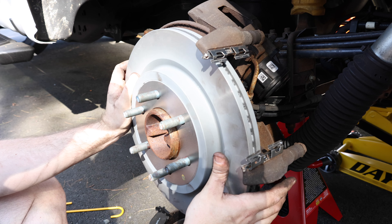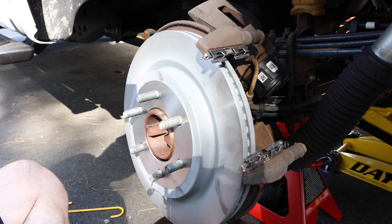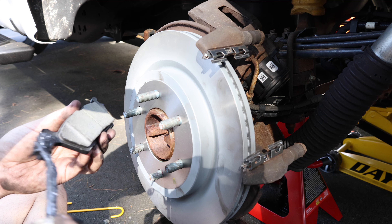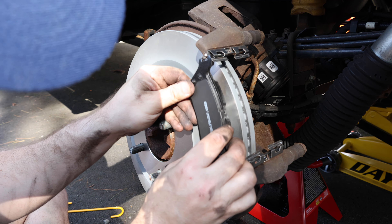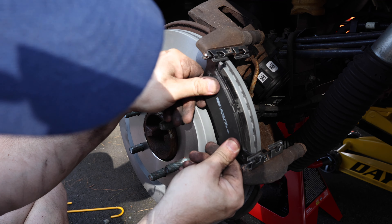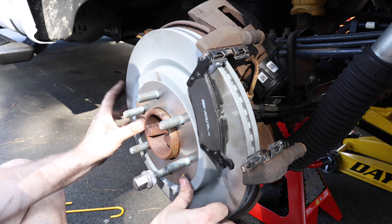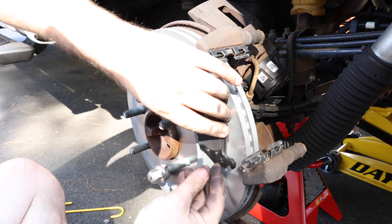I'm going to get this lined up in the center and I'm just going to compress. With the parking brake in maintenance mode it's going in nice and easy. This should make it so much easier to put back together. Now I don't want to push it too far, so I'm going to stop right before it's flush and check where it is — I don't want to push it any further.